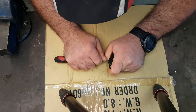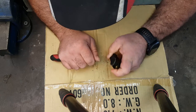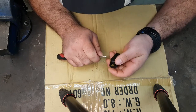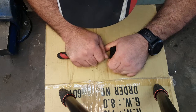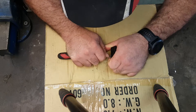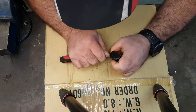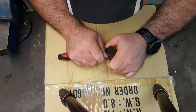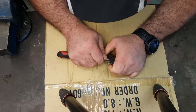Obviously there are lots of different styles of TPS units out there. This is just one of them, and in fact there's a very new style coming out soon that doesn't have this kind of mechanical input. The unit can be made completely sealed, which is going to make them a lot more reliable, because as soon as those resistance values start to change the TPS essentially goes out of calibration, and that leads to all sorts of running problems — cars idle, surge, there's all sorts of stuff going on.